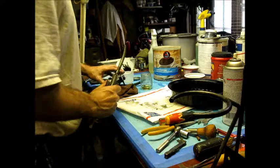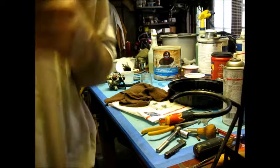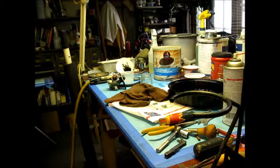I'm going to go back and grab the polish off the magnets, and I'm going to pull the magneto off and bring it over here. I'm going to check it, pull off whatever rust might be on it, and bench test it, and then reinstall it properly. We'll have that done in a few minutes. I'll show you that in a bit.